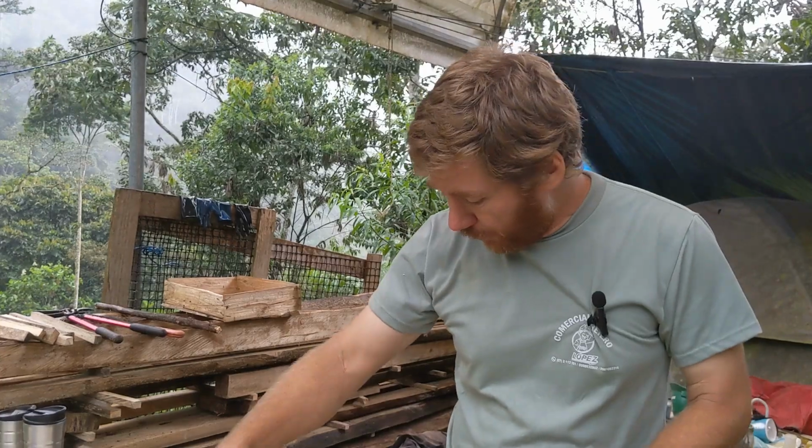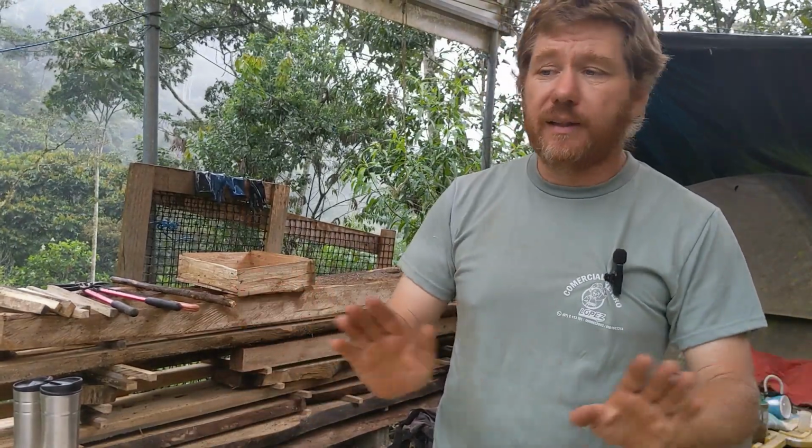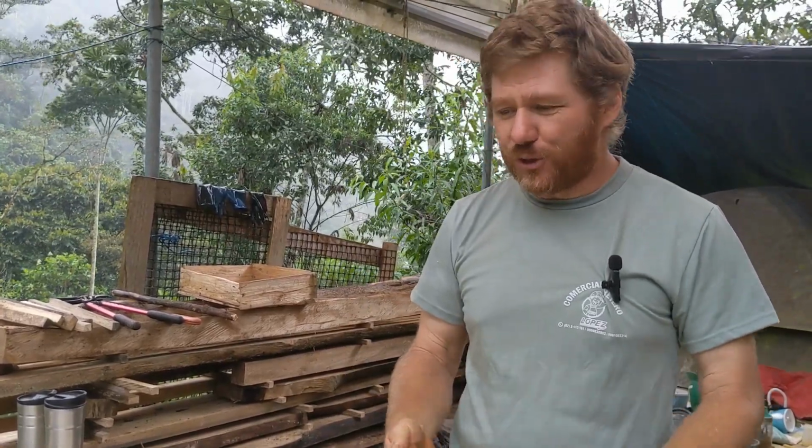That is the bulk of the maintenance a chainsaw needs. Feed it good gas with a little bit of oil. Put good bar oil in for the thing, and sharpen the teeth occasionally. My gosh, you've covered 90% of it right there. You didn't need to get all these crazy specific things, and people get super overly picky about all that. And I'm sure there's a bunch of official people who use chainsaws all day long and have done this for 40 years who are going to tell me I'm somewhat wrong and I didn't do this exactly right. I'm like, yeah, that's the advanced level. For the beginner level, this will do you.